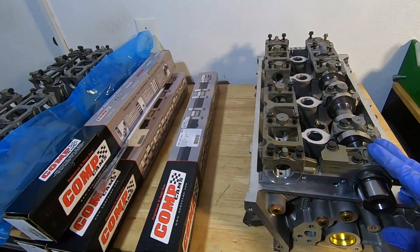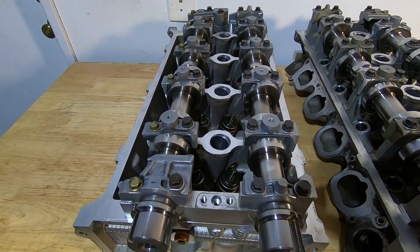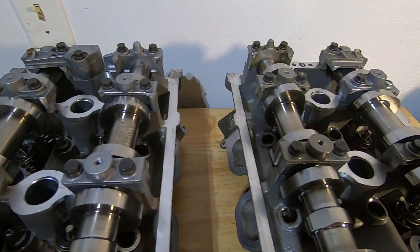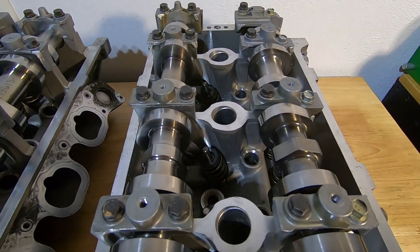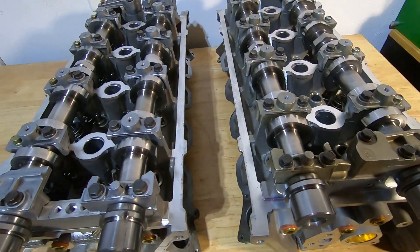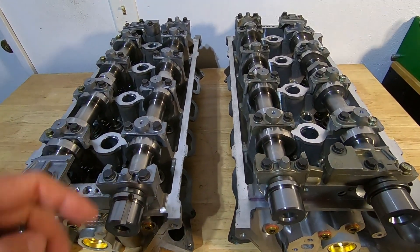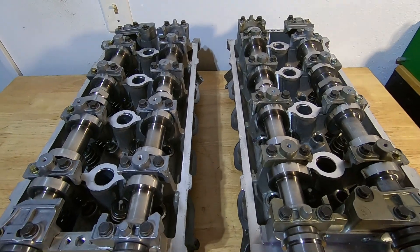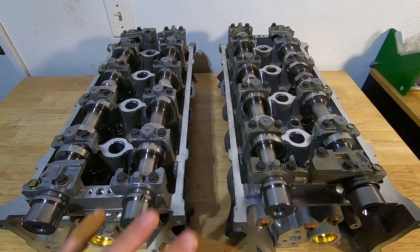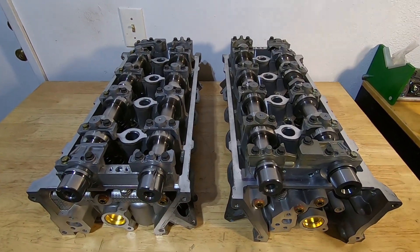Only seven more to go. Here's a shot of both cylinder heads — completely done. I think they look great. It takes a little bit of time doing each girdle, but if you take your time and make sure there's no interference and plenty of clearance between each of the cam lobes and cam caps, even cutting them and then grinding them down, that whole process took a couple of hours, probably close to three hours, but it turned out great. Thanks for watching — if you want to follow along on this build, make sure to subscribe.